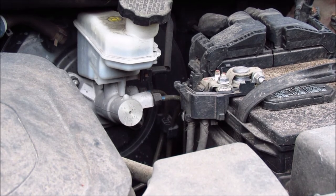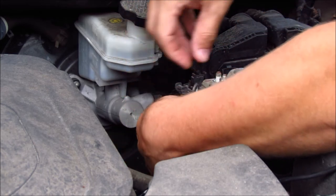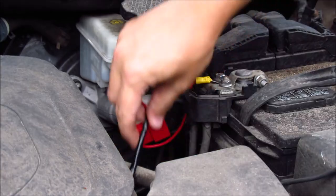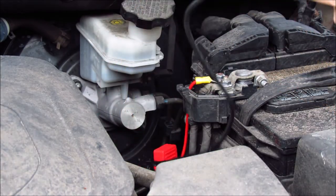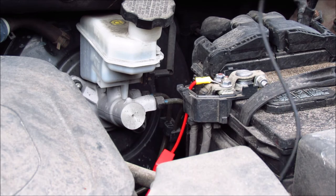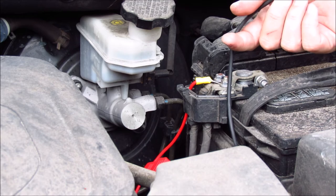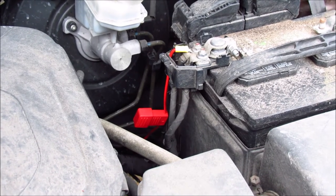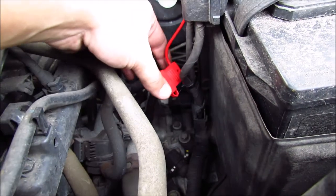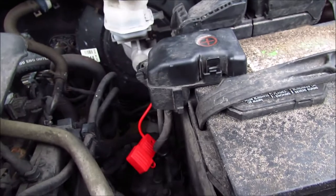Back up at the front of the car, we need to find a suitable place to run this wire. First I'm going to tie it off at the battery terminal, positive side. There's a small opening here that I'm going to run up through, and then anchor it down with the existing nut. Then we're going to fish the wire all the way down through the engine bay, staying along the driver's side rail as much as possible — avoiding any fuel lines or moving parts that could bind up the wire. You don't want it touching anything that's not solid metal you can secure it to. Once fished down, I zip tied the red wire off to some of the pre-existing power wires so it can't move around. We can then put our cover back on and we're done up front.